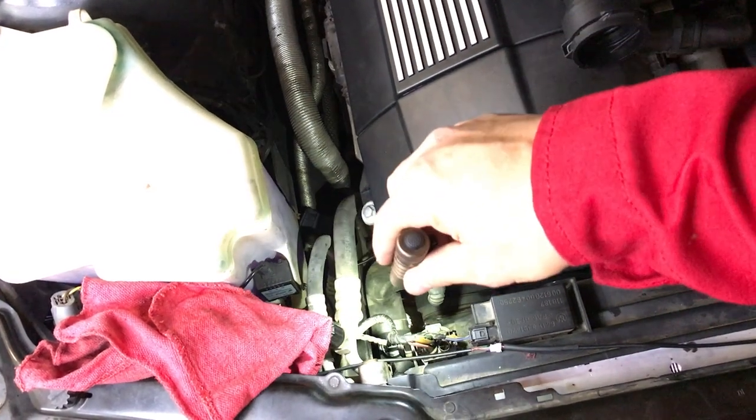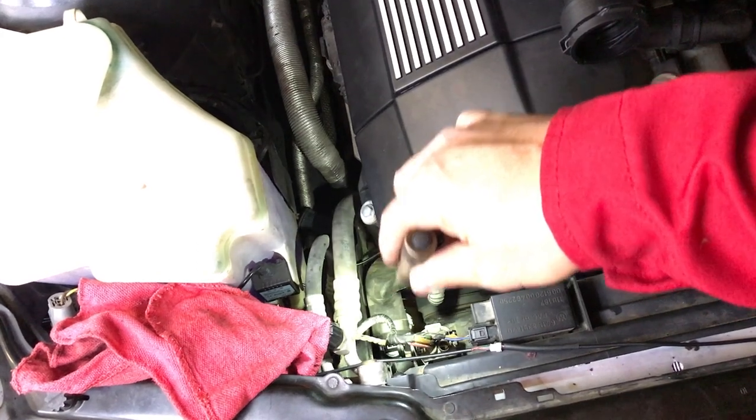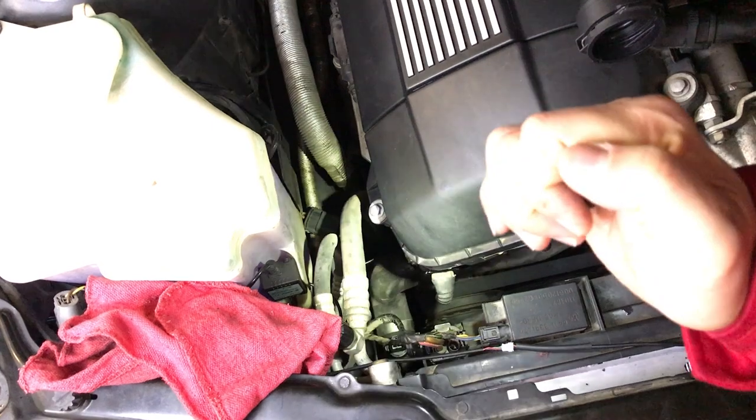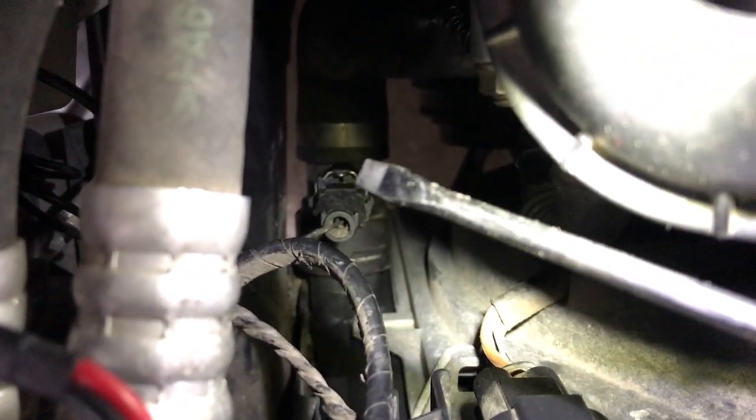For this lower hose on the radiator side, at the bottom where the lower radiator quick disconnect is, use the metal hook and pull straight up from the top, then go under to pry it out. On top of this lower hose there's a sensor — pull this clip out. Reach your hand in there and press it towards the forward, squeeze it into the sensor itself and then pull up. It should come right out. Press the little clip into it and lift. Then pull the clips on the quick disconnect, pry it off, and feed the hose from the bottom up.